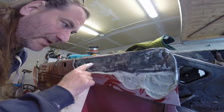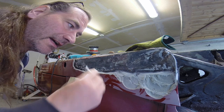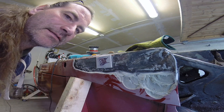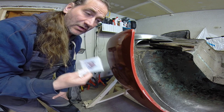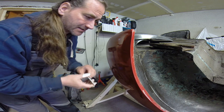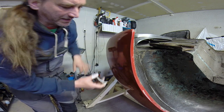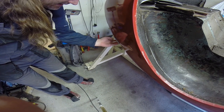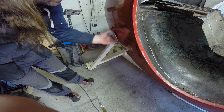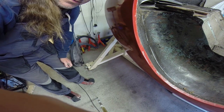We have this bit which looks to me like it's been salvaged from a fridge, so what we need is a fridge magnet. It's a Bobcat — short for Kate — if you got that joke, it means you're really old. Anyway, the back end — this is the rear wing section. I did get the repair panel for up here. The magnet will stick down there, but gradually there we go, it doesn't stick anymore. And if I go there it sort of doesn't stick at all, so I think we all know what that means.